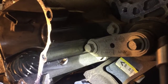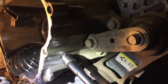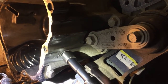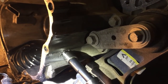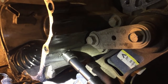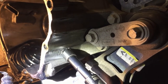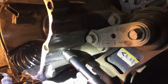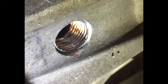I'll try to show you with one-hand operation how it works. You insert the tool in the hole, and once you start turning it, you have to apply some pressure. Those teeth you see on the side will cut a little groove into the body of the PTU. Because it's hard to do it with one hand, I'll do it without the camera and show you how it looks. This is how it looks after I use the tool.